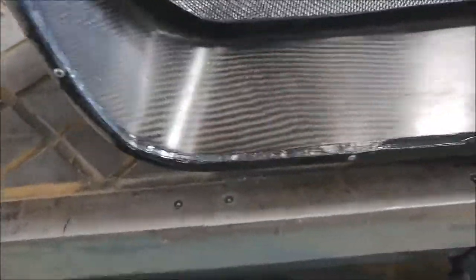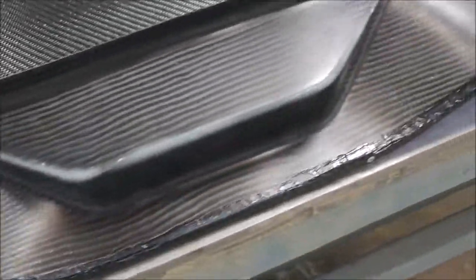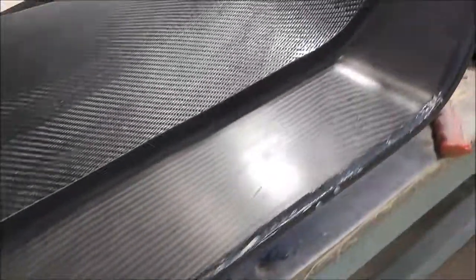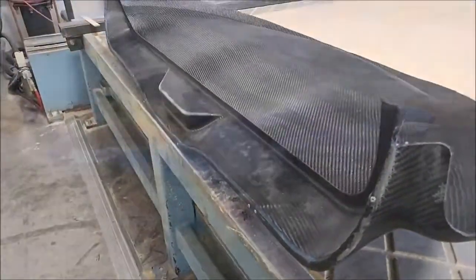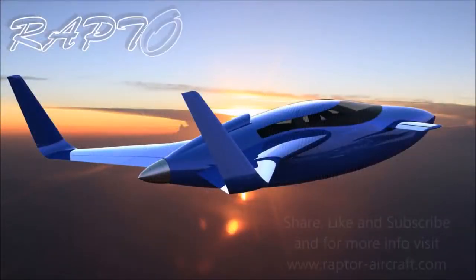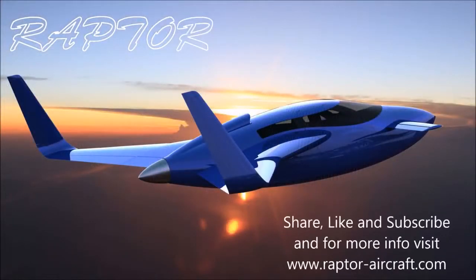The goal is to have that whole glare shield piece covered with some ultra-suede, which should look pretty nice. I've mixed up some resin and cabosil and joined the two pieces together, with some rivets in there just to hold them — those will be drilled out later — and then a little sanding before getting it covered. Anyway, that's our update for the second half of this week — thanks for watching.